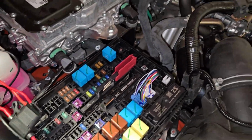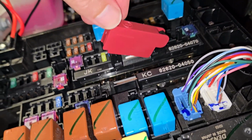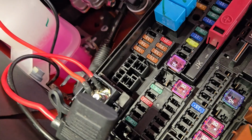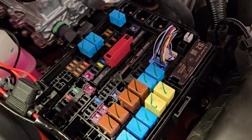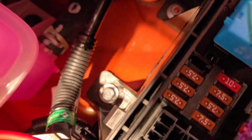And that's where you connect the red end. And then whenever you're done, you can close that lid. For the black one, there's not necessarily a ground to connect it to, so anything with a bolt should work. Just looking nearby, that bolt right there would be perfect.